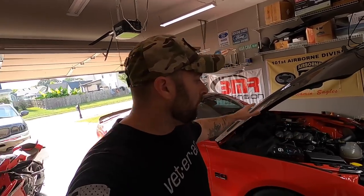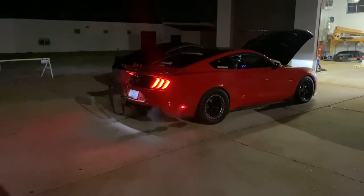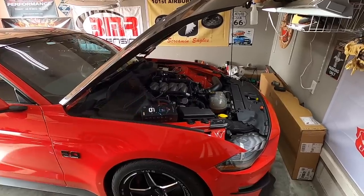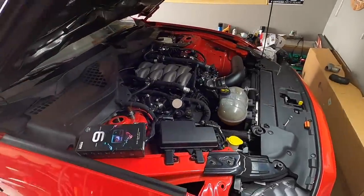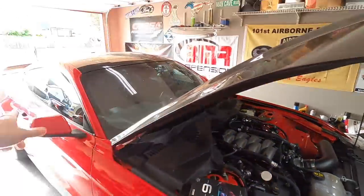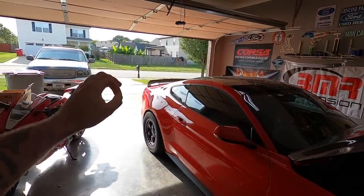What was happening before was with the crank wire it was working, but when we went to launch the car it would go crazy and almost act like it was in limp mode. We did have a tuned revision sent to me — still the same problem. We think we just need to relocate the wire. The plan is to open this up, move forward, replace the wire, test out the two-step on the street, and see if it works.